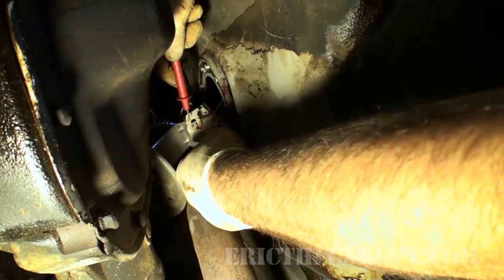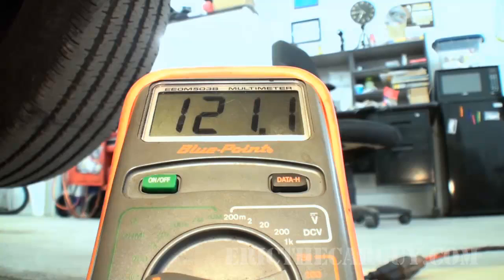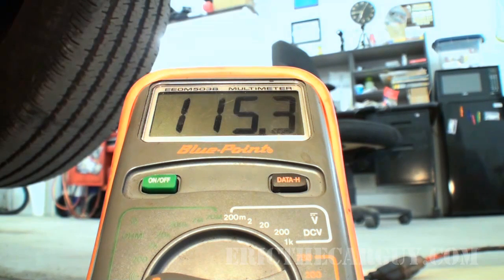So at this point, I'm fairly certain that there's an issue right here. Or maybe not. According to the numbers, it's a nice even transition. It's just when it gets up around that 100 ohms is when the auto range turns off. Alright, Eric, you must have been inhaling too much gasoline that day, because it's not the auto ranging that disconnects at 100 ohms, it's the audio indicator. So the audio that indicates that you have continuity disconnects at 100 ohms, not the auto ranging. Please disregard that previous statement.